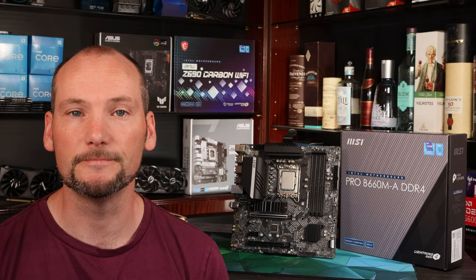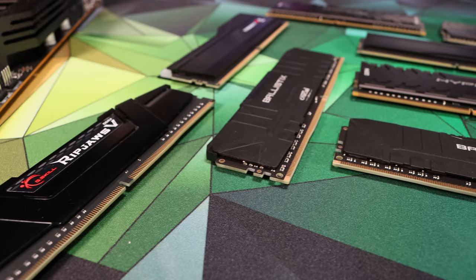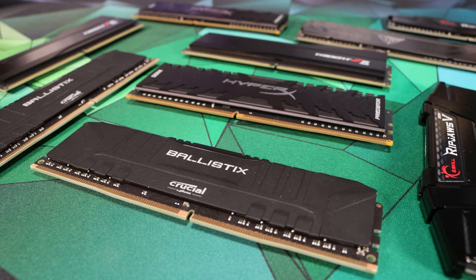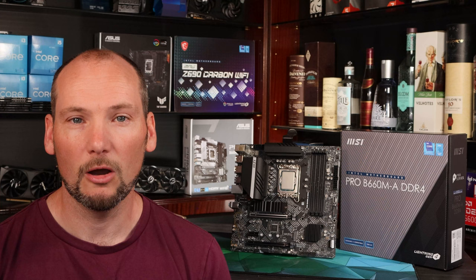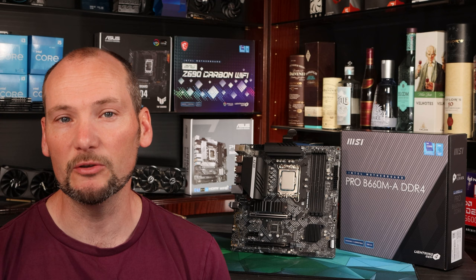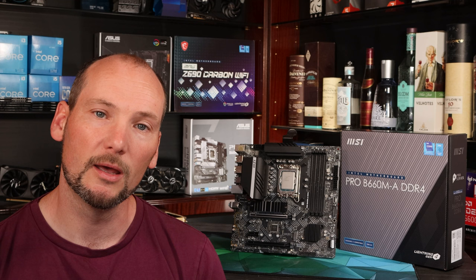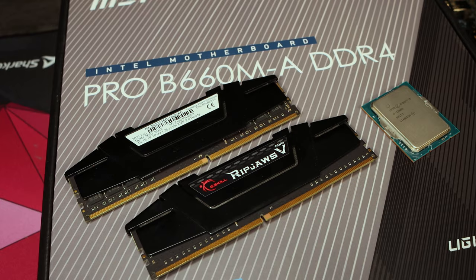Moving on to RAM performance, there's been a lot of interest in how this motherboard responds to higher speed RAM. It's a DDR4 board and the sweet spot for DDR4 lies around 3600MHz CL16 in terms of cost and performance of those RAM kits. However a number of people have reported problems stabilizing 3600MHz RAM on this particular motherboard with i5 CPUs, which we investigated. When looking at RAM overclocking the three key factors in order of importance are: first the RAM specification and speed, secondly your CPU's memory controller and its flexibility in running high-speed RAM, and really the motherboard is the last part in the chain — a combination of motherboard quality, signal trace quality, and BIOS flexibility.